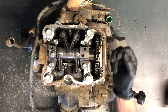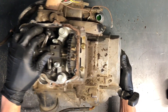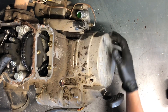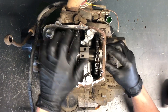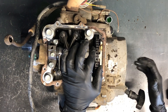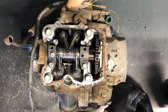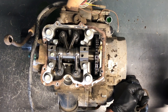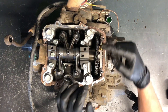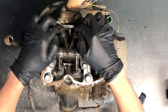Those two dots will be straight up, and there's a line on the top of this sprocket here that will be straight up as well. You can turn the engine by pulling the recoil cover and turning by hand, or just carefully pull the recoil/pull starter until it gets to the spot. Once those two dots are parallel to the top of the head, we can adjust the valves.